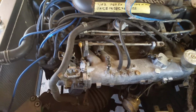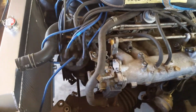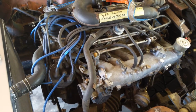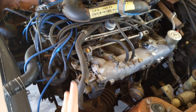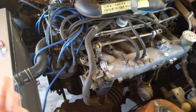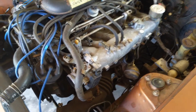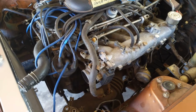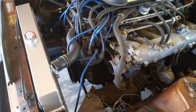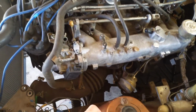Well, they were cheap mounts, and in the middle of putting the new ones on, really all the bolts, which are brand new stainless steel M8 by 1.25 bolts, were just really hard to get in. I really should have tapped them out. I remember reading reviews about people saying you need to tap them out first because they're cheap, and they painted the inside of them after they were already drilled, so it makes them all gunked up and really hard to screw in. And I was using a ratchet that was a little bit too big, so I totally screwed up and ended up snapping one of the bolts off after I'd already gotten the engine in. So there goes another like 2 hours of me trying to fix it, and I realized it was going to take me like another week and a half to get more engine mounts.